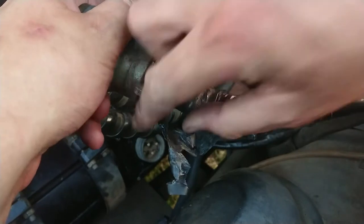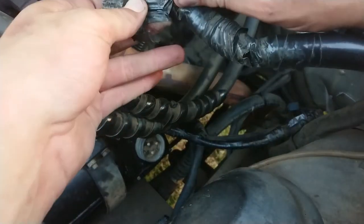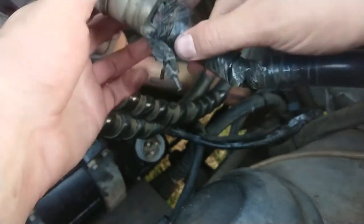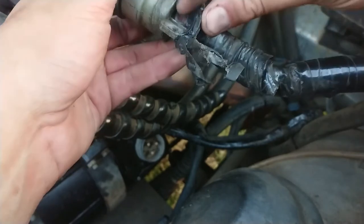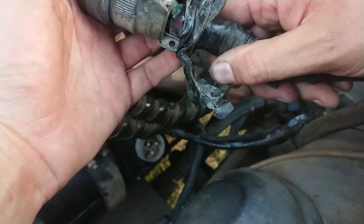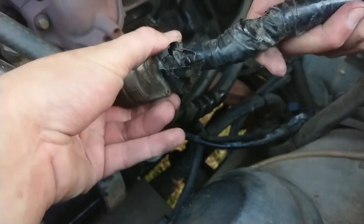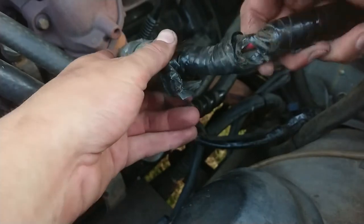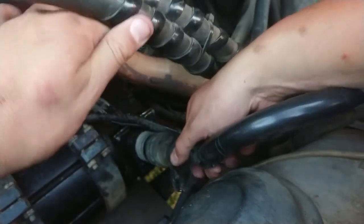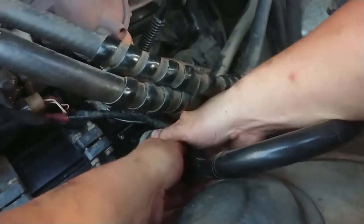This alternator is pretty unusual on the inside — it doesn't have an inner armature, it's just got a laminated steel core, but it has twin windings on the outside with control windings in between them. There's a bit of green corrosion in there, but I'm going to leave that for now. It's just two wires covered in loads of insulation tape — we'll neaten that up in the future once we're sure things work.